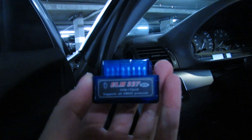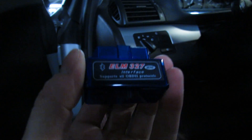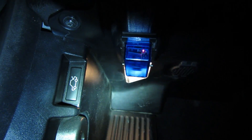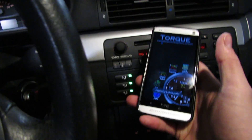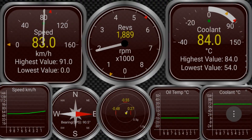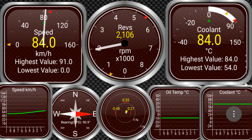If you want to check the temperature of your BMW precisely, get an OBD2 to Bluetooth adapter — it's about $6. Plug it in underneath here, and once you turn on the engine it should connect to it. Now we're on the highway and it's staying at 84 degrees and right at 12 o'clock. When the thermostat was stuck open it would decrease the temperature and get pretty bad.